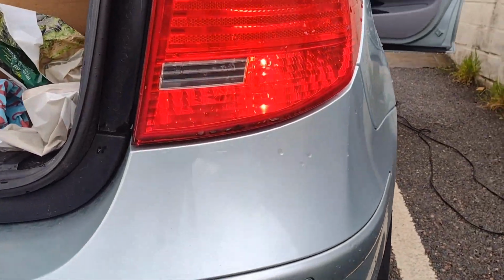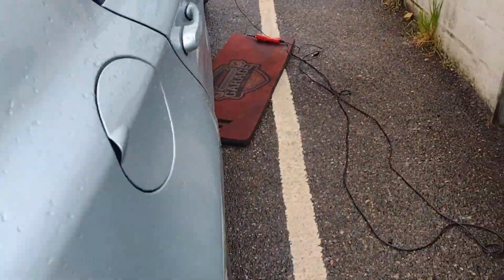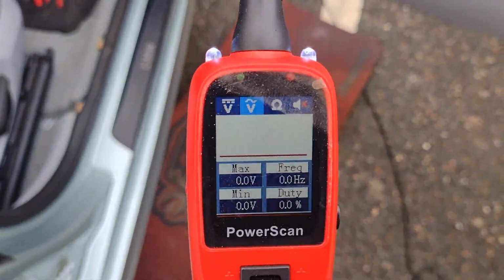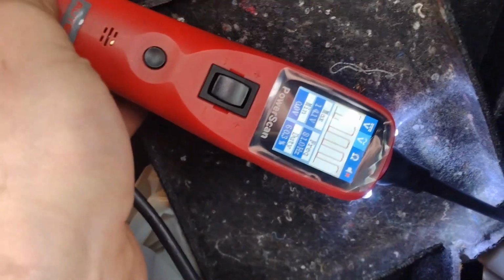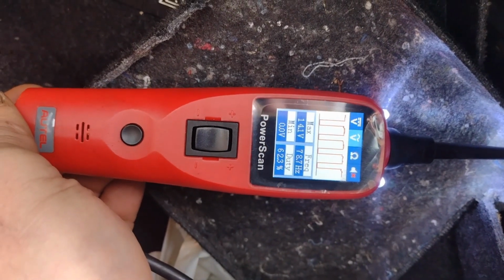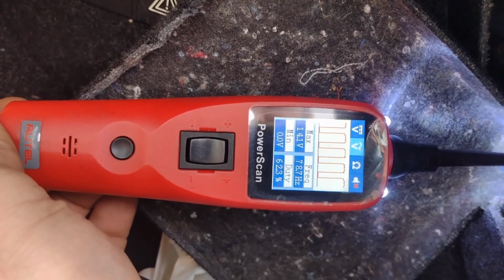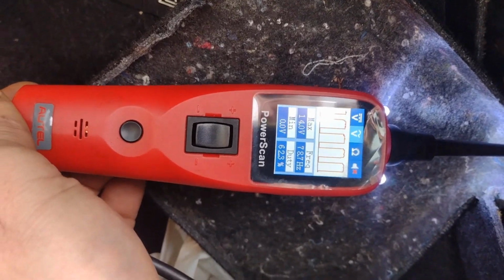Side lights come on, a little bit dimmer than when it's the brake lights. Okay, same bulb, single element. I'm using this, it's got a little graph. Now stick it into the wire. Actually, I could have done this at the front of the car. See that one? So it's roughly 62% duty cycle, and it's on-off battery voltage. And that'll be the same on this side.